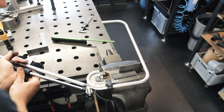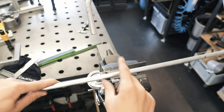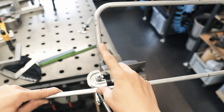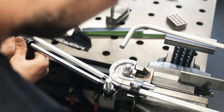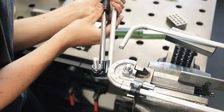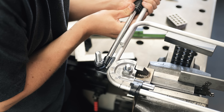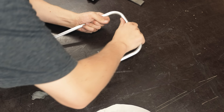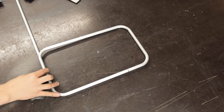Of course I gotta watch out for the bends to actually stay in the same plane, so I put a spacer on the vise to keep it level. The next bend is where it gets interesting, because if this isn't exactly in the correct location the ends are not going to match up — and that's what's kind of nerve-wracking about bending stuff. If you mess up the last bend on a workpiece like this the entire thing becomes trash instantly. Bending somehow just doesn't feel as predictable as machining to me, but that's probably got a lot to do with my lack of skill.